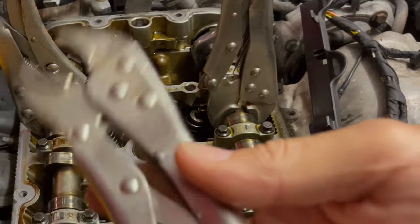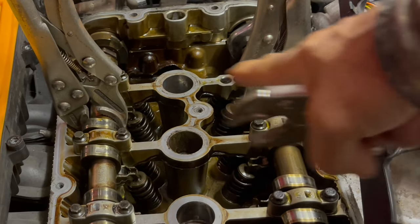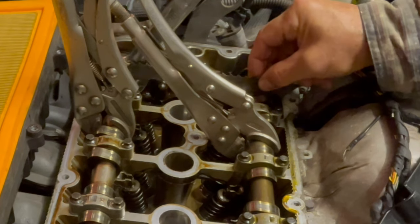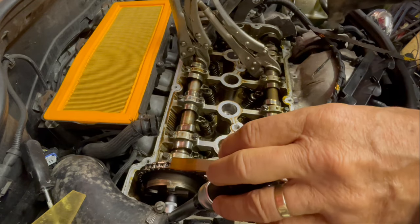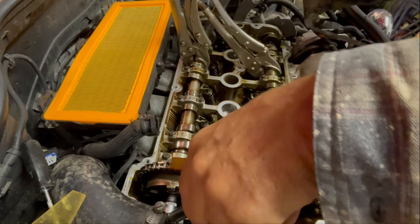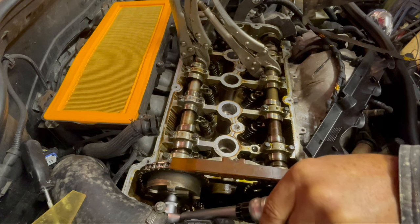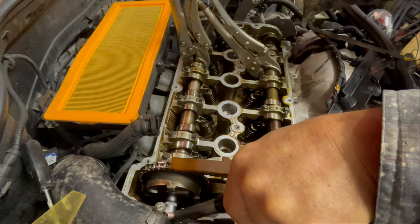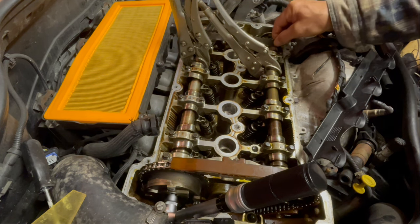I've got mole grips on each camshaft just to hold them in position. These adjustable mole grips give a little bit more fine adjustment and they're wedged against the side of the cylinder head when we have the flats perfectly lining up with each other. The trick then is to first do our 20 Newton metres — we don't really want to turn over the engine, so we need to balance our forces between the spanner we're holding and the torque wrench until we get to 20 Newton metres. This ensures we don't actually turn over the engine or move the sprocket on the cam.